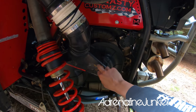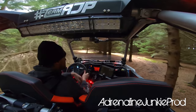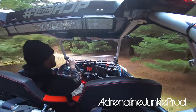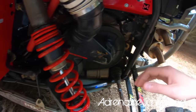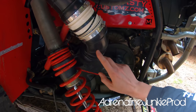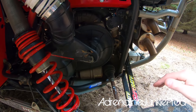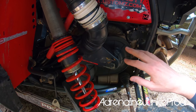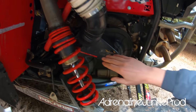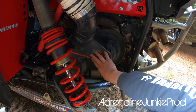There are other mods you can do — some people put an additional hole in there and mount an additional tube that blows air in. The only times I really start running real hot are wide open, high load scenarios going up a hill in West Virginia or Tennessee — foot to the floor for an extended period of time. I haven't had many belt issues since I made these changes. I'm also running the Evolution Powersports Badass belt — it's been the best belt I've run so far. From my understanding, Trinity Racing and Aftermarket Assassins run a similar G-Boost belt, so they're all the same belt just branded differently. I'd say this belt is probably the best, followed by OEM.